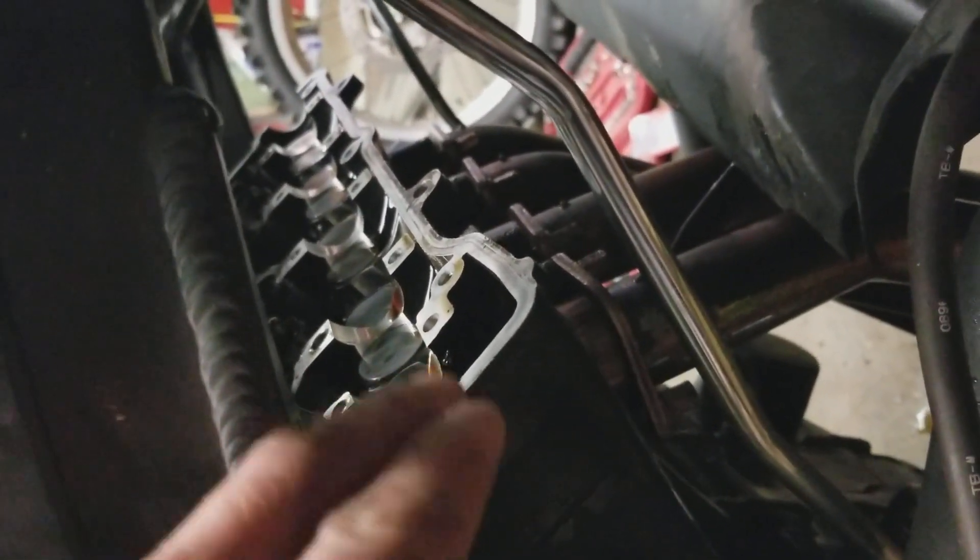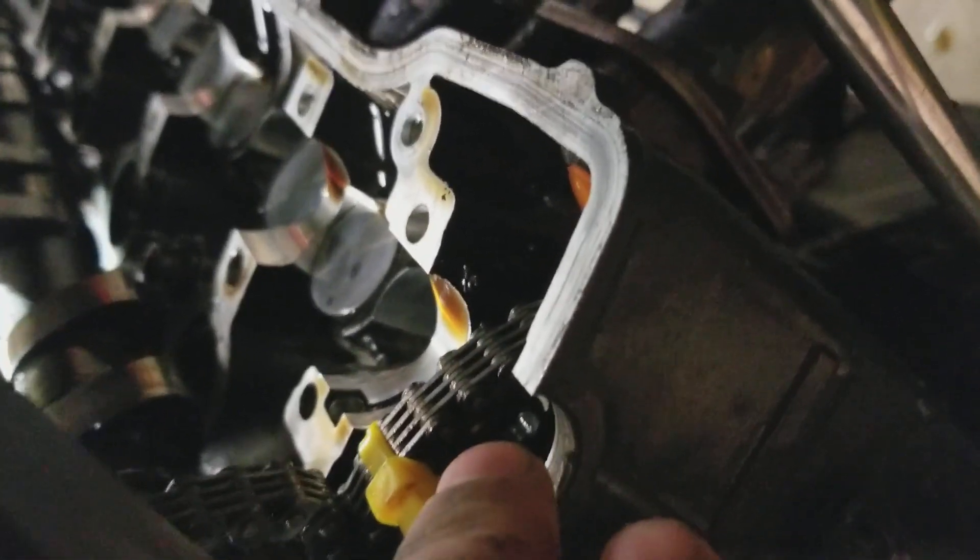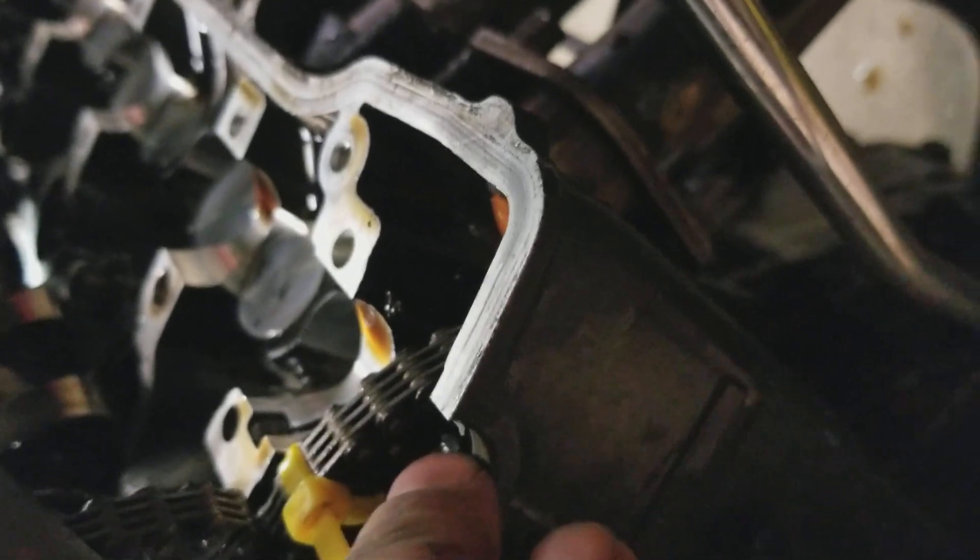I did my paint markings and also a little scratch, because after I rotated the motor a couple times, the paint markings came off the cams. So I undid that bolt and then did a zip tie right there on the cam sprockets, so that's going to be locked to that cam in the same position it was when I pulled everything down.